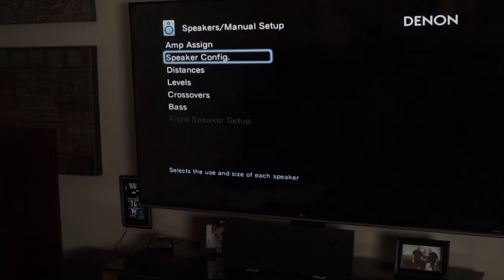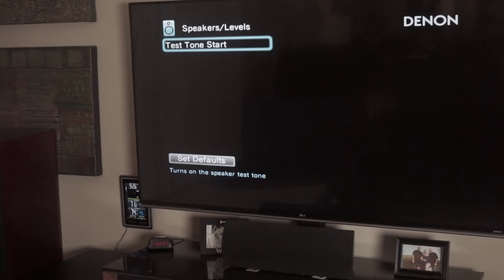Go down to levels and you can do a test tone. The test tone is really good if you've got an SPL meter — I've got one on my phone. If you've got a regular SPL meter, that works to get all your mains set up at the same tone. Your subs, if adjusted right, will probably come in at a lower decibel than your mains. My experience has been that my subs come in a lot lower on this white noise than the main drivers do. This is how I found out my center channel was running way too hot and really muddied up the system. That test tone is a good way to make sure all your mains and surrounds are giving you roughly the same sound level.